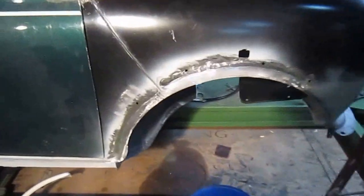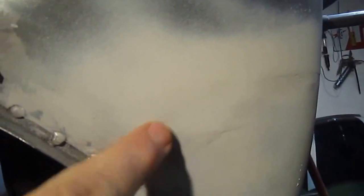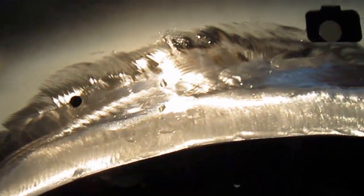Just to let you see how this looks up close — everything's inside and all the lead's in there now. I obviously haven't finished this part yet — I started to do this one as well. Best to put more lead on than less, so I'm going to have to go back over this. I've just put the primer on it to cover it tonight, but I have to go over and put more lead in there. You can see the seam's gone there. The lead edge still needs doing. So there's the edge and it comes down — the water works well on it, it just drips straight off. The water comes straight off that edge, which is what you want because that's just a catch for rust otherwise.